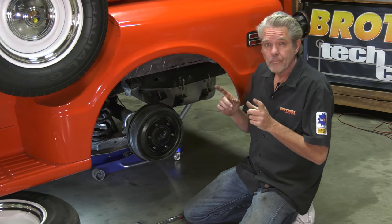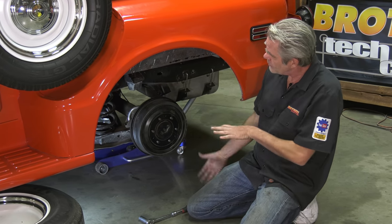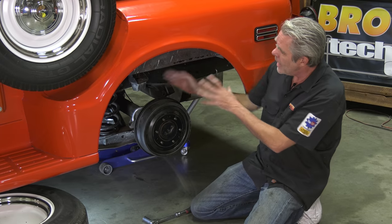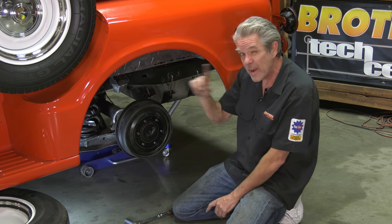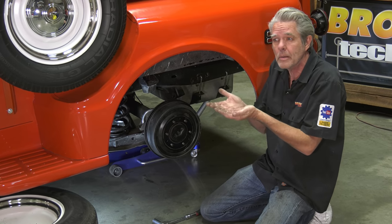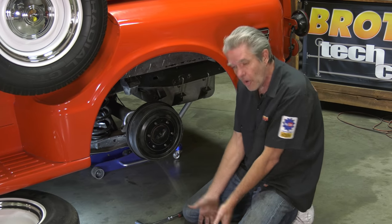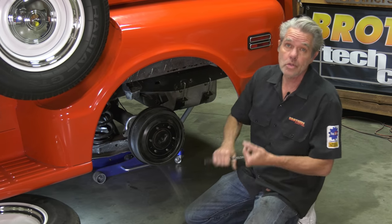Now we're going to get on the rear airbags and I'll show you how to install your lines, your pump, your tank, and wire it all up. Once again we're on flat ground, with tire chocks up front. I've jacked the truck enough to get jack stands on the flat part of the frame. We're going to take out the spring and the shocks — take the shock off first, then the spring. It's very important to have a jack underneath the rear end. Jack it up just enough to take the tension off the spring — not hanging down so it falls, and not too high so you can't pull the spring out.